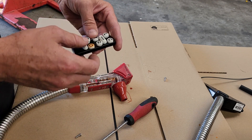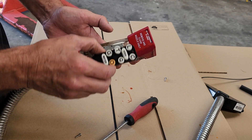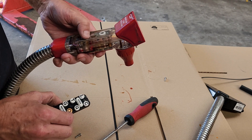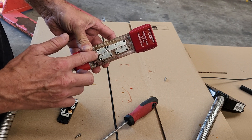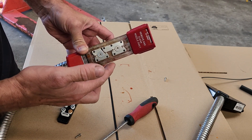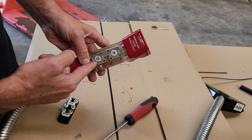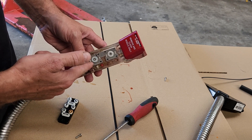So that's what to check first: remove the plate, push this button down and see if water comes out. If it does, make sure the plate is in place. Make sure if you've got orange juice that the plate configuration is correct - this plate there, that plate there - and not one of the long plates. If there's a long plate in the wrong position, water will be coming out continuously.